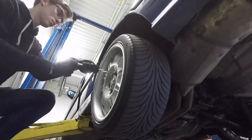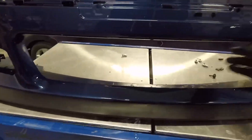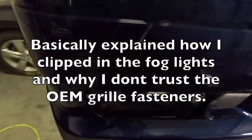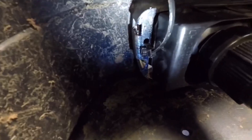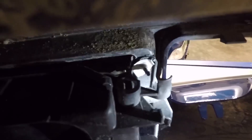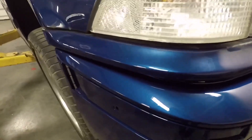I'm not sure if there's supposed to be a bracket here, but I basically zip-tied it using those two holes and it seems sturdy — doesn't move anywhere. Same thing on the other side. For the lip installation, I looked it up online and there are many ways to do it. I put a little fastener retaining clip here and fastened it through the other side so it's not in the way of the fog lights. If you shake it, it sits pretty sturdy and shouldn't be going anywhere.